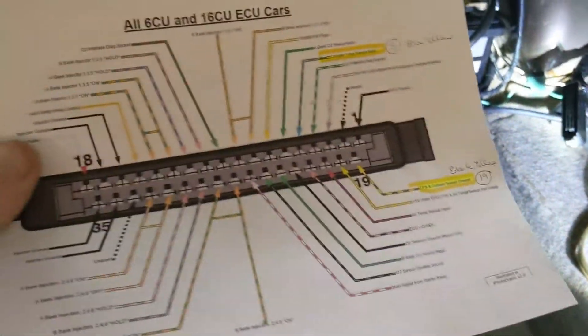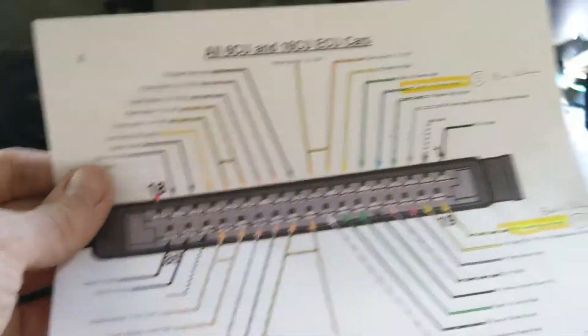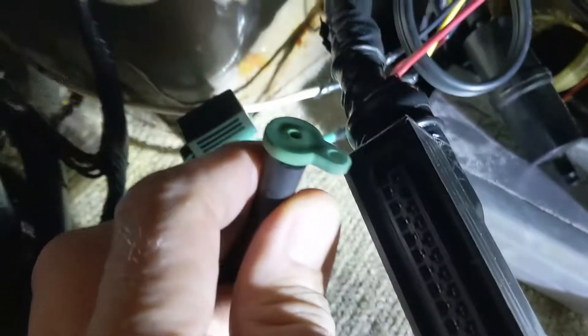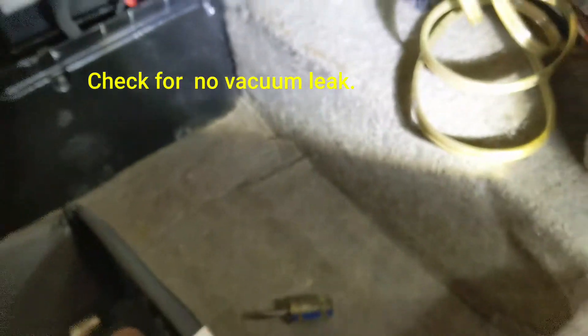The other thing people have talked about is the absolute manifold pressure sensor. That sensor is also connected at the ECU — it comes up under there by this tube, which goes through what looks like a one-way valve, though I'm not sure what that is yet, and down here. I've just disconnected it because I'm going to plug it and check it.